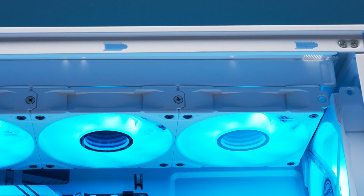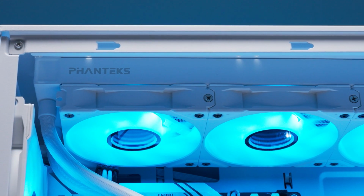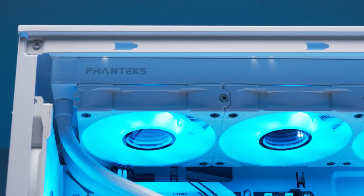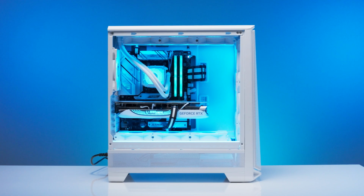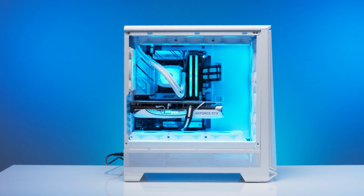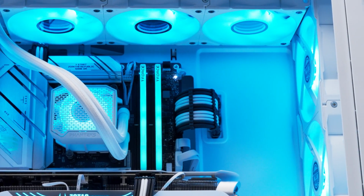But even with the railing, a 360mm radiator will fit-ish, but they don't have a whole lot of wiggle room themselves, especially if you choose to keep the stock 140mm fan in the case rear, which, like we did, but then you can't mount all the screws. So because of how tight this section of the case is, with both front intake and rear exhaust fans living inside of the main chamber, it forces builders to be more aware of the size of the radiators.